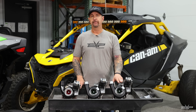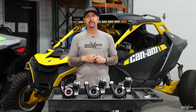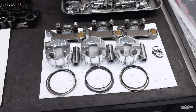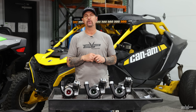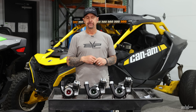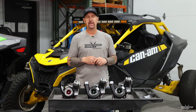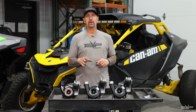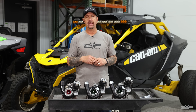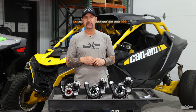The other two turbochargers are the P48 and the P50. These are going to be for customers that want to do an engine build — whether it's a mild engine build with a ported head and cams, pistons, rods, ported head, oversized valves, our valve train, and slightly higher compression. We go nine and a half to one on the compression ratio on all of our builds. That would be for the P48. It spools great. I just drove the car that's behind me and it's absolutely seamless — it actually spools a little bit better than the P47, because of the turbine flow of this turbo and the A/R on the exhaust housing. We really wanted to make sure that we kept the great spool characteristics even though we're going bigger.